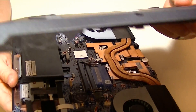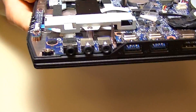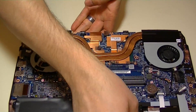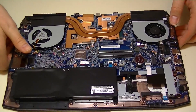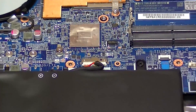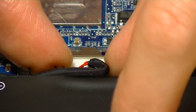If you have a laptop with a removable battery, go ahead and remove that first before you take the case off. However, on this particular laptop model, the battery is built in inside, so removal of the battery is not an option prior to disassembling the case. But once you have the opportunity to disconnect the battery, that's the first thing you'll want to do, just to reduce the chance of electrical shock or shorting out any parts of the computer.